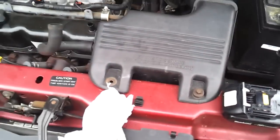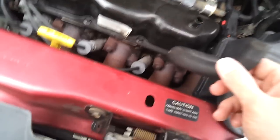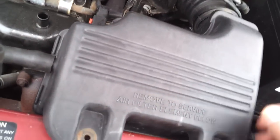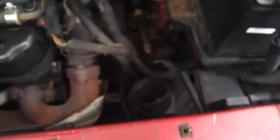What we're going to do is get the airbox off. For any of you that haven't done this before, you've got two 10mm screws right here, and you have your little breather here for the valve cover. I already did a little loosening here, but you could use a flathead or a 7mm — you're going to have one here and one here. Just disconnect it and unloosen it. Here's your airbox down here. If you can get to the clips, it's pretty easy. Just undo the two clips and pull the airbox out.